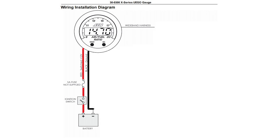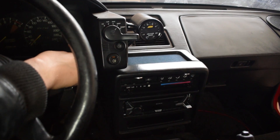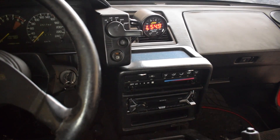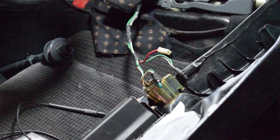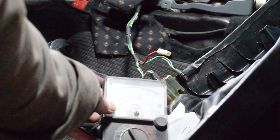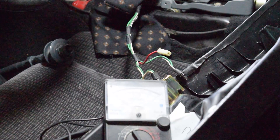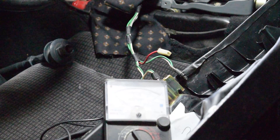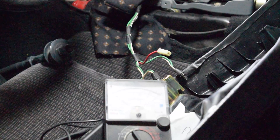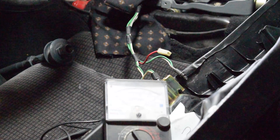As you can see on the diagram, the wire powering the gauge needs to be an ignition-switched wire. This means that when you turn the key on, the gauge will be switched on, and when you turn the key off, the gauge will be switched off. Inside your passenger compartment there are plenty of power sources just like this, and what I did is tap into the wires for my cigarette lighter because it's easily accessible and it meets the ignition-switched criteria.